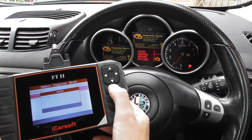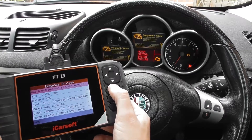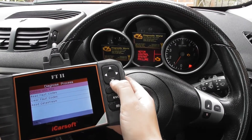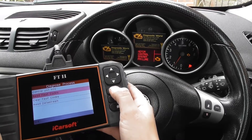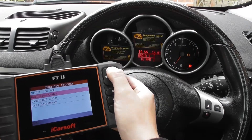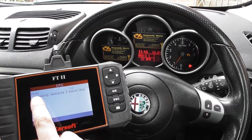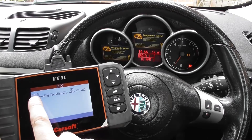In this case it's the engine, so we need to find our specific engine which is this one here. Click into Read Fault Codes. There we go — and we've got a fault here: P0155 and P1155.